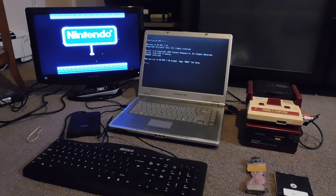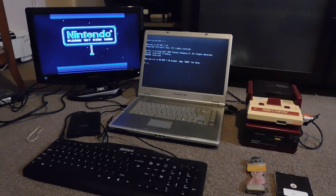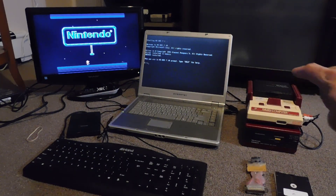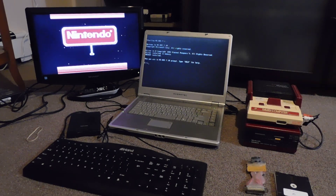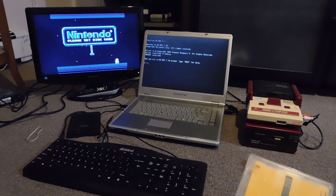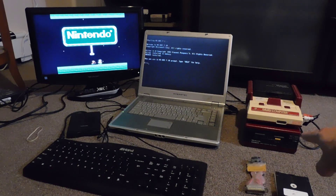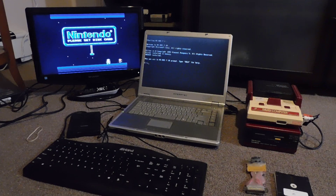In this video, we're going to go back to the late 90s and I'm going to show you an old method by which people used to write their own games onto Famicom disks. The Famicom Disk System uses a mini disk type of floppy disk — not a conventional format, I think it was made by Mitsumi — and these things are designed so that write capability is completely closed off. Nintendo did this through modifications to the internal power supply inside the Famicom Disk System, and also on the drive itself there's a chip that prevents writing.